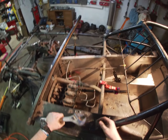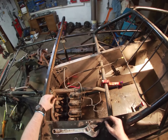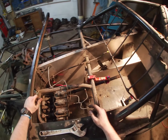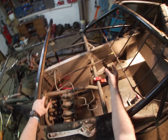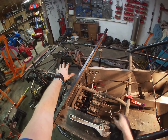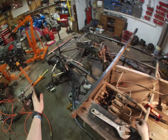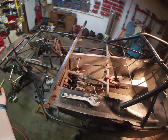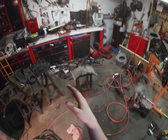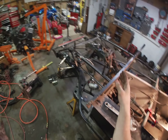Now, in a lot of late models and even some classes of modifieds, they have what they call a right front brake shutoff. So they'll have another lever basically inside the car that shuts the right front brake off. And what that allows you to do is, this side of the car has more brakes than that side. So when you hit the brakes, it'll turn the car down into the corner. So if you shut the right front brake off, you basically do that if you're super tight getting in.